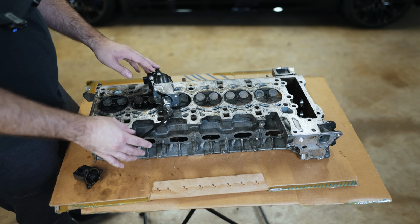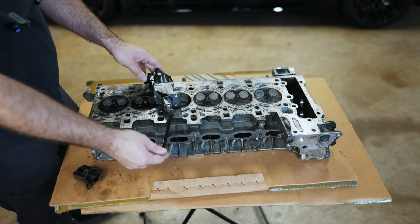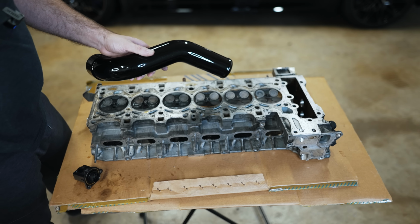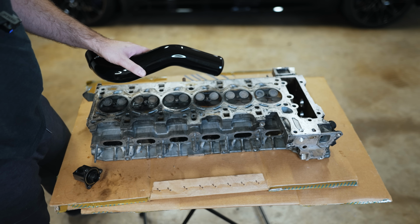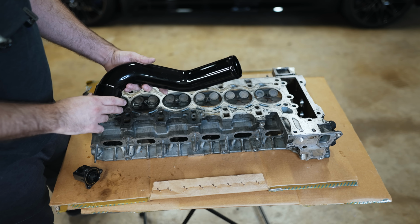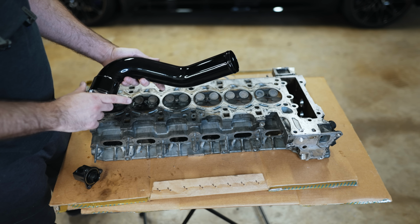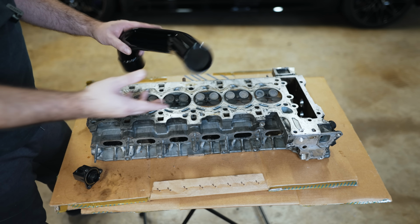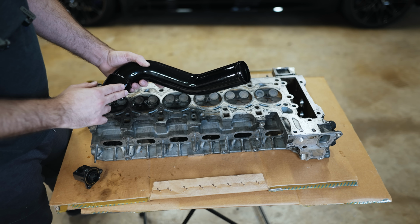they can do it. If they're good, they won't need anything but the valvetronic and the wastegate. But if you want to upgrade your turbo and get the sounds and make things a little more fun and old school, that's where this kit would come into play. This only came out a couple weeks ago, so I figured I'd be adding value to the B58 community by talking about this new kit and showing you how it sounds at stock boost pressure. But really, I wouldn't recommend it unless you're planning on doing more tuning or upgrading your turbo. It's a good preparation mod and it gives you that theater, but really, I want to show you what to expect with the stock car and the upgraded blow-off valve.